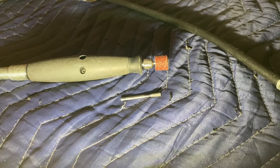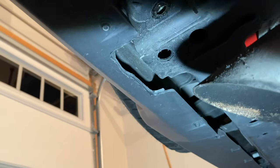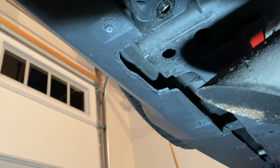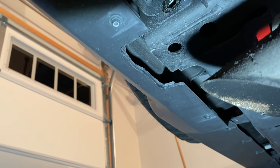I'll cut it out and then be able to install the tow loop. I used a routing bit and a sanding roll with my Dremel to create the cutout on the passenger side. The sanding roll cleaned it up after I cut through.